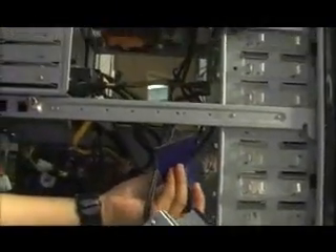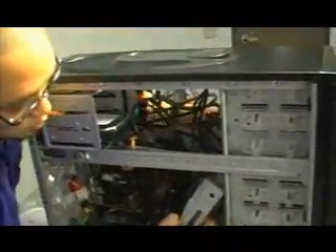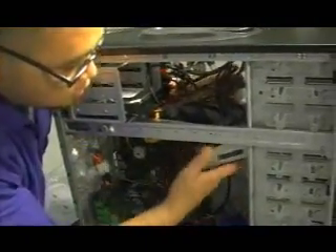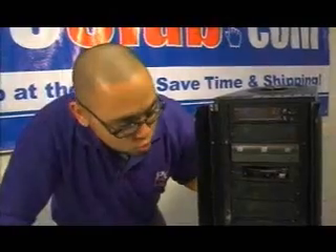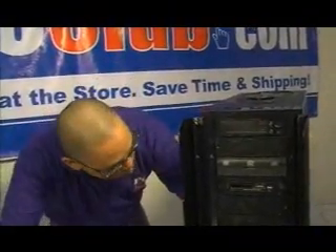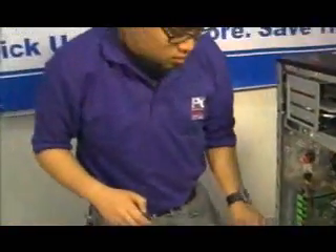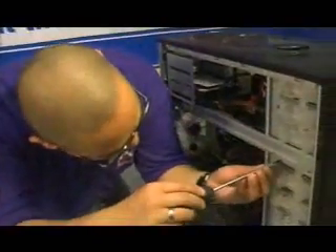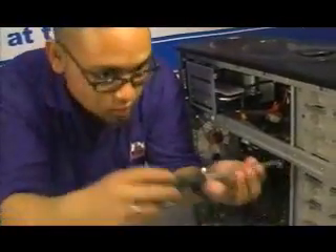Then I'm going to take this. You probably have to take off the DVD drive, so I'll take that off for now, then plug it in and slide it in right under the DVD drive like that. Match up the holes right here — these two. Get your screwdriver, put your screws in. Plug it in on both sides, remember — both sides, so it'll be stable.